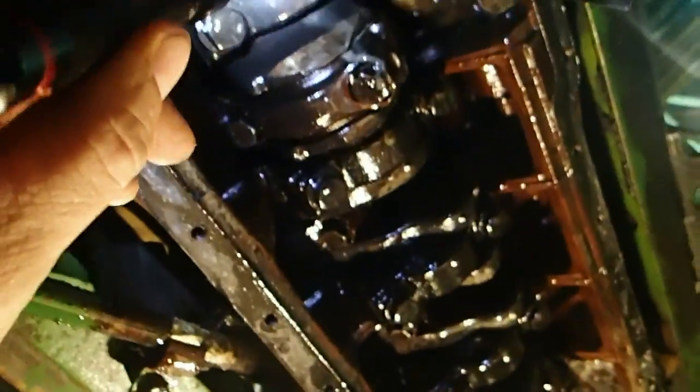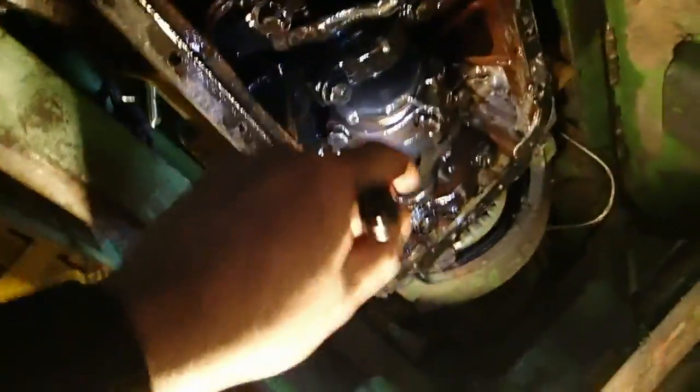this portion of the pump up, and then I'm going to get under here, because here's the other half of the gear pump. This is the driven side of the gear pump, or the drive side, that's the driven side. This engine does, there's nothing wrong with the sleeves that I could see. But what I'm going to do is actually pull the mains and the rods and change out those bearings.